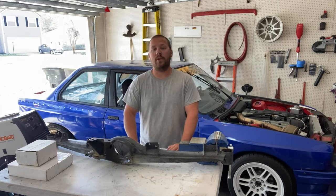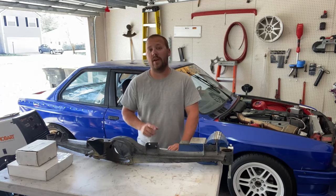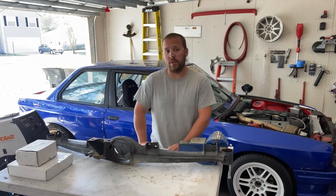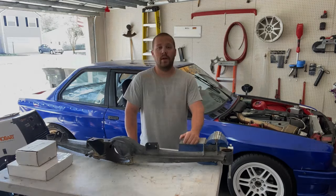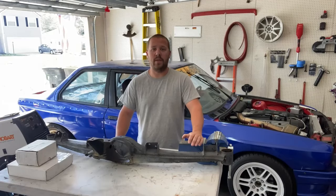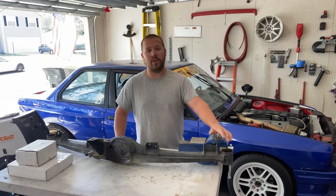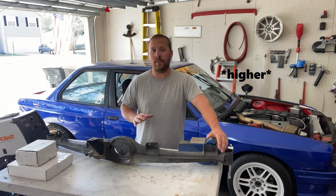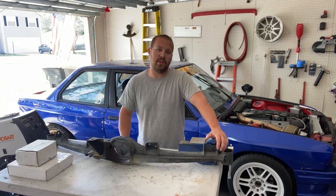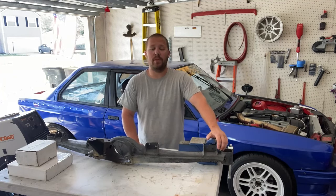Now, if you saw the last video where we went to the track, the E30 had no issues whatsoever, but there are a few things we can improve to make the chassis better now that we're making some more power, and the biggest thing being grip. My car does have a good bit of natural camber just from being lowered. I do have subframe riser bushings, which places the subframe and the chassis a little bit lower to try and compensate for some camber, but there's still a decent amount in there, but I've been using that to my advantage without having any power over the last couple years.